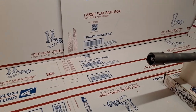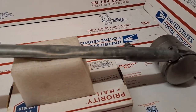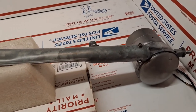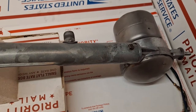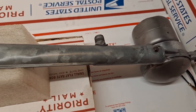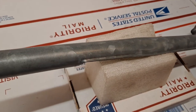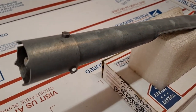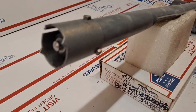This is the 1960 Cadillac Fleetwood Original Vintage Power Antenna that has been fully restored, as depicted in the predecessor videos where the unit was completely torn down all the way to the final screw. The motor was fully restored, including the five-gear movement of the gearbox, as well as the rewinding of the armature, and the servicing of the telescopic mast that was missing.